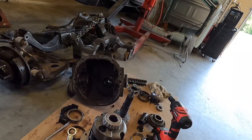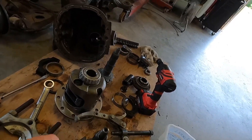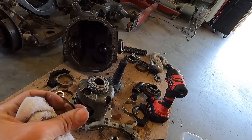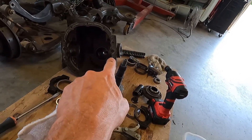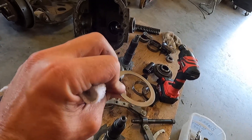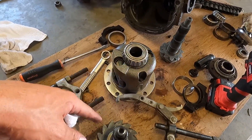Since we're getting all new well pinion, ring, and bearings and everything, it seems silly, but we had to disassemble that just for this shim — to try to meet or match what the factory must have determined was the right depth. So we have this shim now, and we can put it on the new one and press a bearing on, assuming that we're at the right depth.